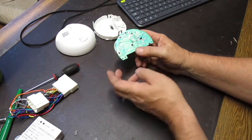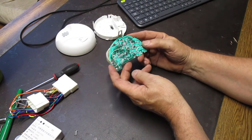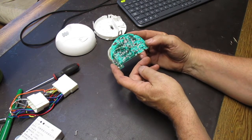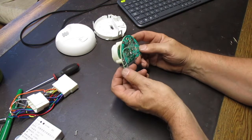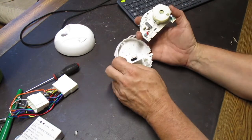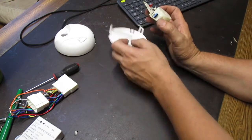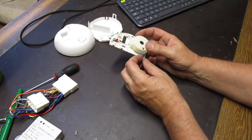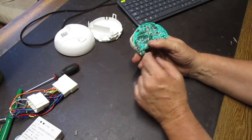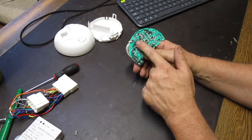This thing runs on a 9-volt battery, but it will also run off 12 volts. And it'll take a maximum of 15 volts, so it can run off the car's electrical system. So here are the connections for the power, which, if you see, it's got this 9-volt battery. These pins connect to these 9-volt battery connectors, but you can just remove all that, and then just use these pins. And if you connect the 12-volt input to this pin on the chip, it will immediately fire it off.